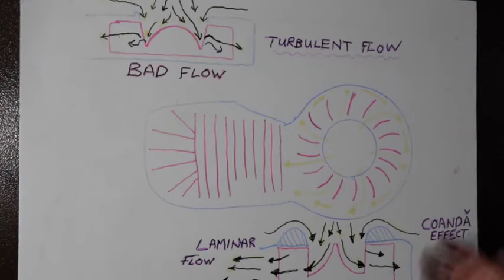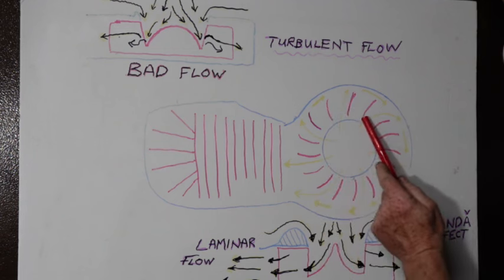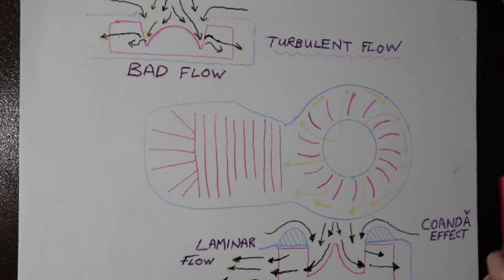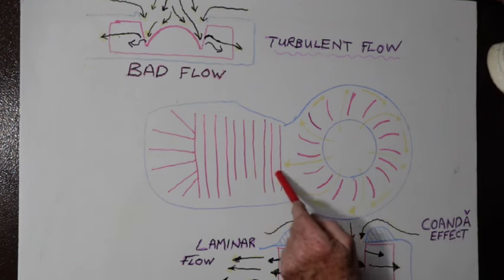On to the whiteboard — we've done a few sketches here to show what we mean by airflow and how it works. This is our centrifugal fan used for cooling the cylinder head. All the fins have got an attacking curve on them in the direction the fan spins — that's the most efficient style of fan for low RPM. If you want to move a lot of air at low RPM you use this fan, and since a Lambretta engine doesn't reach 20 or 30,000 RPM, this is the most efficient fan to use. It sucks air in the middle, blows it out, and pushes the air around and then over the cylinder.